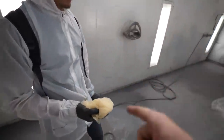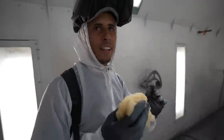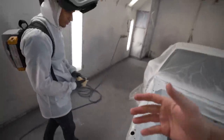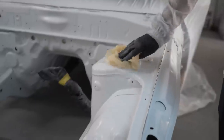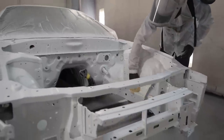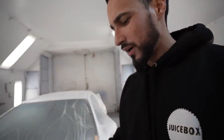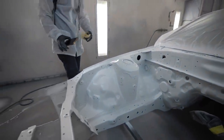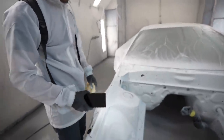What is this? A tack rag. So it's kind of like a sticky cloth — if any materials got dusted on the paint, this is going to pick up any dust in the paint job. This is what you do between the base coat and the clear, because you don't want dust under the clear. Two eyes are better than one — inspecting for dust and dirt. Especially with white it's called snow blindness, you can't always tell. Normally you call somebody over and look at it with a light to make sure every spot is covered.